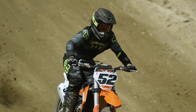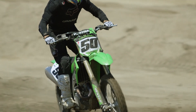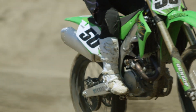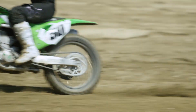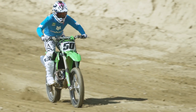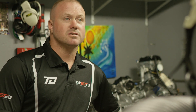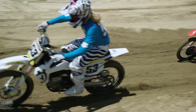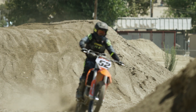It's no secret that all the factory teams show up to Glen Helen to test during motocross season on Thursdays. It's one of the gnarliest tracks in our area — the hills are very steep both going down and up, and there's a lot of acceleration chop. Most people feel that coming down the hills, once we free up the engine braking, the forks go higher in the stroke, they're more plush and more functional, and riders feel more confident bombing down the hill knowing the bike isn't going to unload. It's a great event for us because of that customer engagement, and if you can make a difference somewhere like Glen Helen, you know it's real.